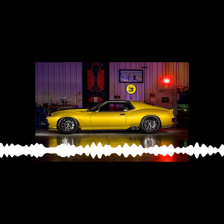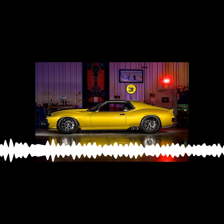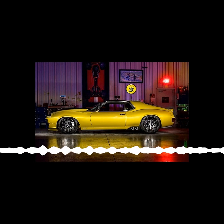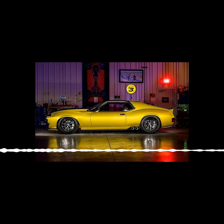So you put it in dry and spray glue it in place, because we're putting a triangle, meaning we're splitting the weave. Instead of just running the weave of the carbon all the way across the hood, we're actually angling it, so right down the center we're laying the carbon up so it goes both directions. It's peaked in the middle, basically, which is a lot more complicated. They do make a weave that is done, but the one we got was poor quality and we didn't want to use it. So we cut it and spray glued it in.